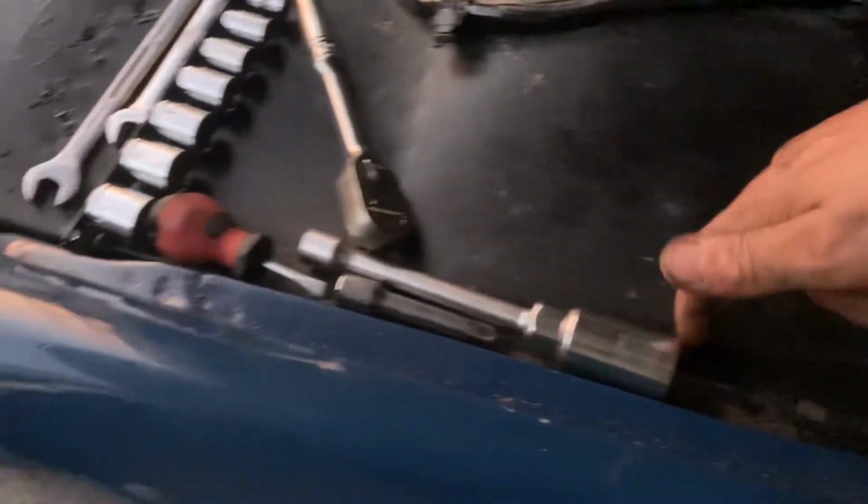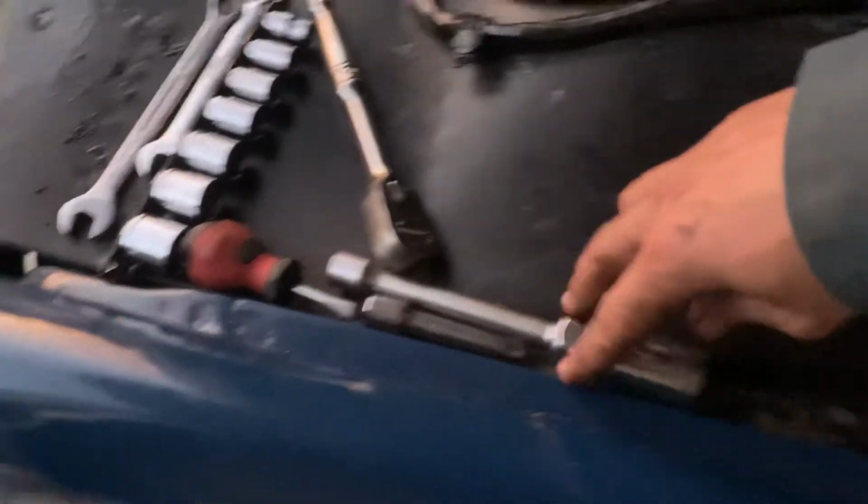And that presented us with this, which obviously some of the P6 people out there are going to go, that's nothing. And yes, I know, I've seen a lot worse. But yeah, it's quite squishy. So I'll basically be cutting there all along, down to about there, and putting a whole new section along there. Because I guarantee this rail behind here that this rubber sits on, the rubber's been painted the same colour as the wing, because whoever painted this can't paint.